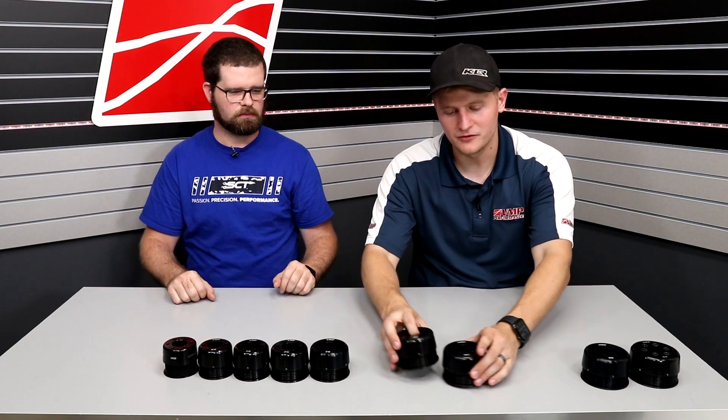These are a good option for guys that aren't quite at the level where they need an 85 and don't have ready access to race fuels, and they just want to party a little bit harder — they got bored with the power the kit made stock. The 85 and 82 kind of fall into their own subsection: this is going to be really pushing it on pump gas with a boost cooler, or like a mild race fuel setup, but not something you can just run on 93 octane. Pretty much not in any scenario.